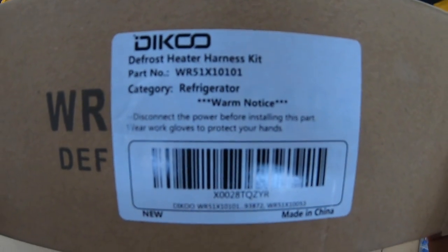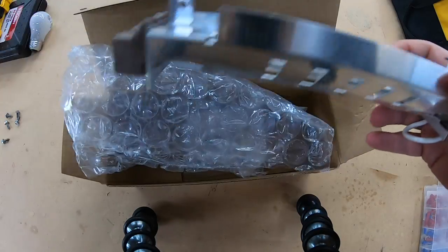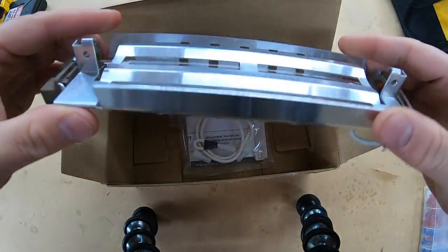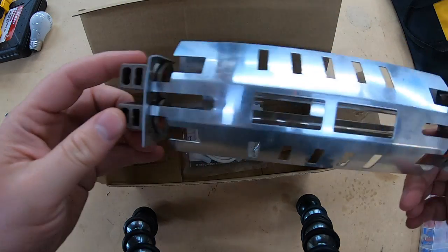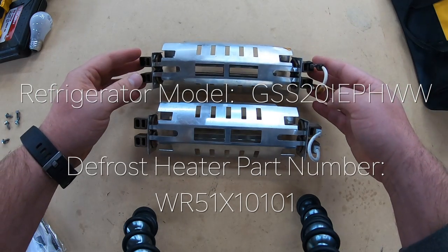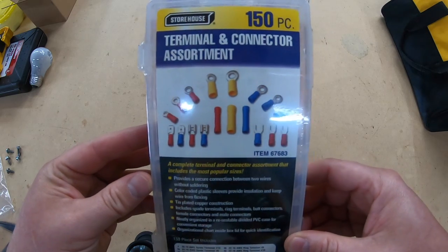And here is the new unit. I'll leave that part number and a link to this actual part in the description below, and as you can tell, I paid about 13 bucks for this. So to find the part that you need, you can always look up the model number of your refrigerator and find a parts list. That's what I did. But in addition to that, always match up the old part to the new part to make sure they're exactly the same.